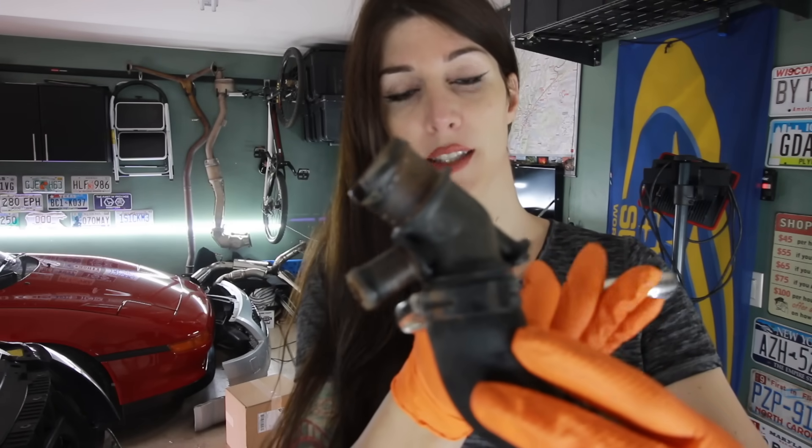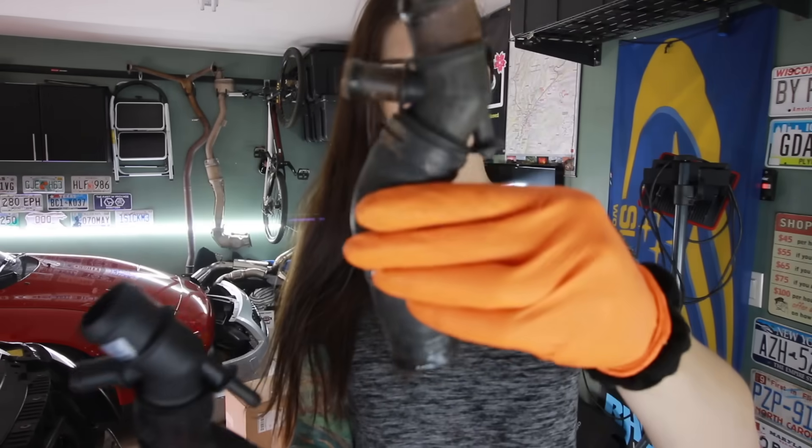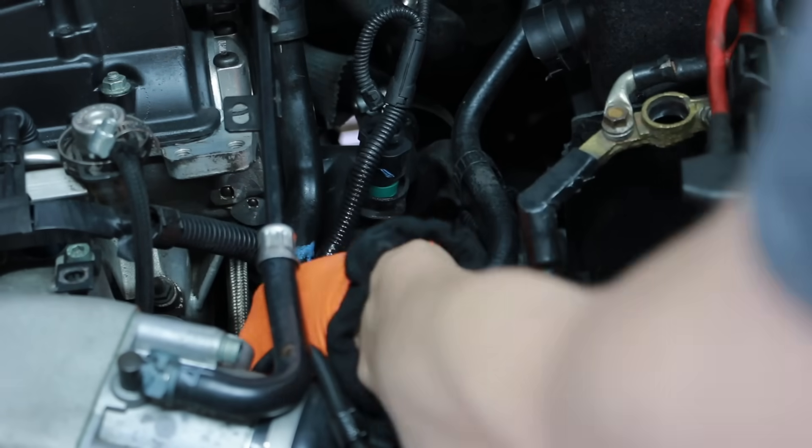They do make aluminum versions of these — I found aluminum ones online. However, if I wanted to replace all of these with that aluminum kit and replace every coolant hose on this car, that's like another $500, and I just don't have that kind of money to dump into this car. So as much as it kills me to only replace what I can, I wish I could just go crazy and replace everything, but I gotta keep this realistic. I'm replacing this hose and this pipe. New one? Old one. That's gonna need some lube.